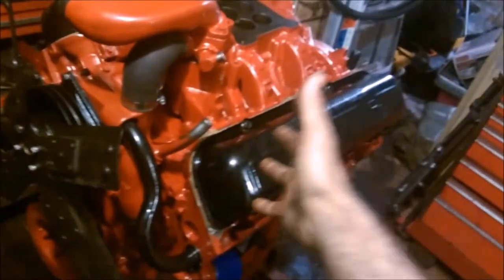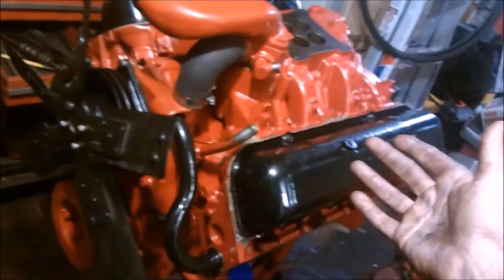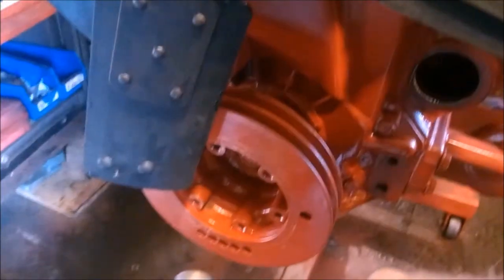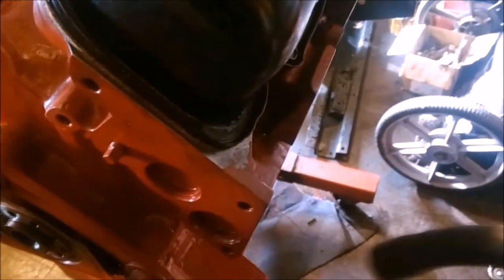Now we have it back to the point of before you were afraid to take it apart. We'll rotate until we find top dead center. We can poke in that hole to feel the piston at the top. We could smoosh a piece of hose over the end here — it blows right out the exhaust port when the exhaust valve's open as we turn it. Now at the marks lined up here again it's blowing the hose and it's sealed — that's the compression stroke. We're going to rotate all the way around again until those marks line up.